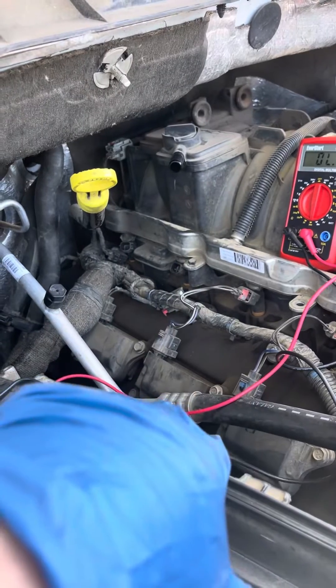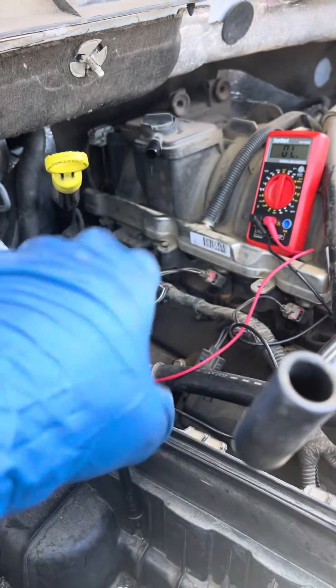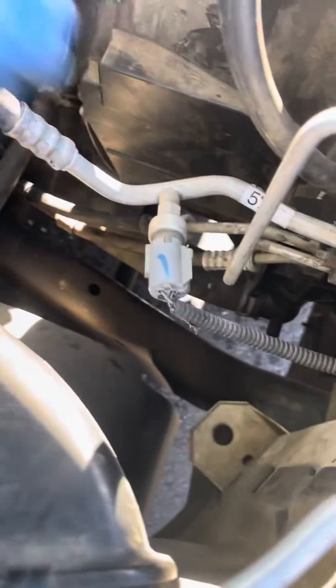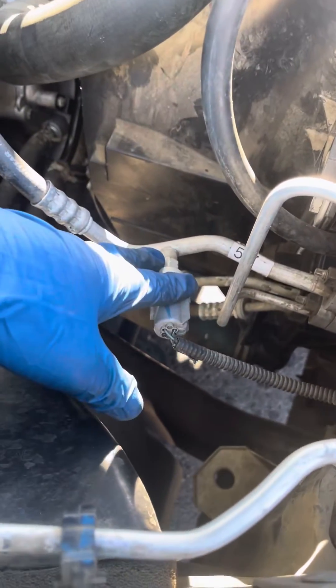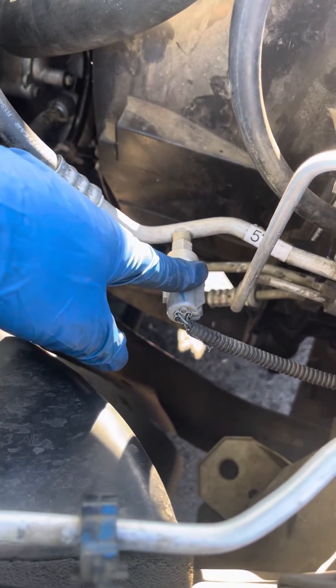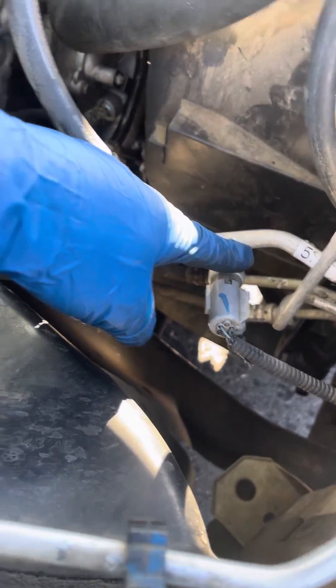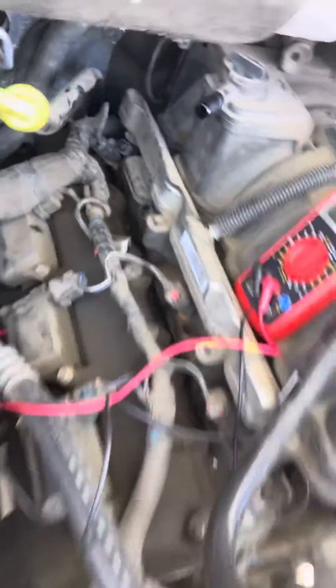You might be wondering: how is there power in there? This isn't the power going to the injector — this is the resistance inside the actual part. Each part, say this sensor here for your AC high pressure cutoff switch, has resistance inside it when it's disconnected. Any electrical component with two, three, or four pins is going to have a resistance of some sort. If the resistance is off, the injector driver isn't going to work and squirt the fuel at the right rate, or it'll just fail altogether.